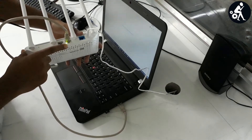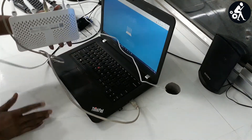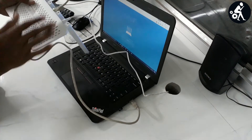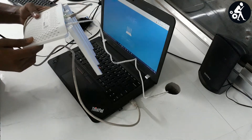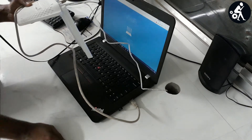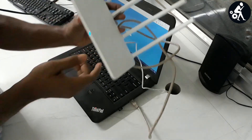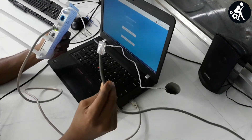Now configure it on your PC. The configuration page should open automatically in your browser. If it doesn't open automatically, you can visit miwifi.com after connecting the router to the PC. You can see the blue light indicator. Click the 'I Agree' button to continue and you can set up your Wi-Fi network. You can also use this router as a repeater for extending the range.